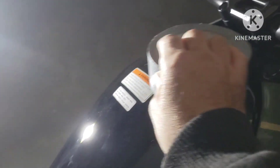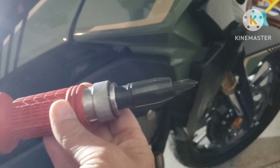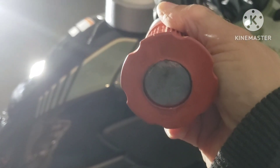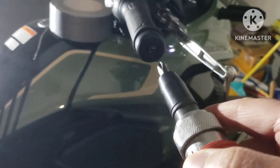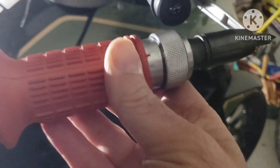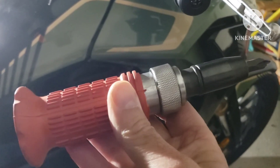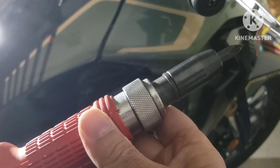The tool you're going to need is an impact screwdriver. If you've never used one before, you put the screwdriver in there and you pound that end with a mallet, and the force of pounding it will twist and loosen the screw. Do not try to do it with just a regular screwdriver — all you're going to do is strip that screw and then you're going to have to drill it out. Buy yourself one of these; they're fairly inexpensive at most tool stores.